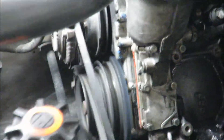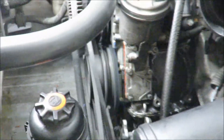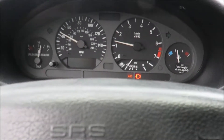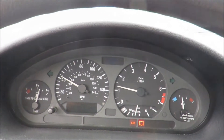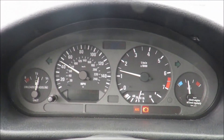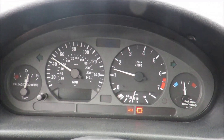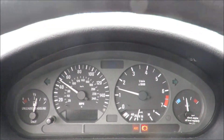I got the oil filter housing back on. I put some RTV in it again, snugged them down a little bit, gonna let it sit for about 30 minutes so it kind of hardens and cures, then I'll tighten it up. Then I'm gonna start it up to make sure it's not leaking before I assemble everything again. No more leaks — we are good. We're driving the E36, it's not leaking anymore. I'm gonna drive it for a little bit, check it to make sure. Gotta go up to the car store and get some oil for it, it's really low.